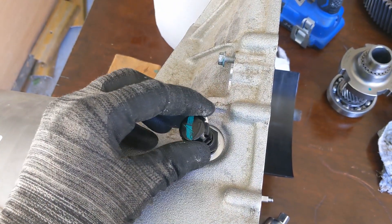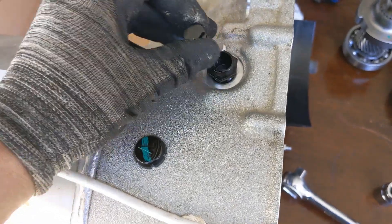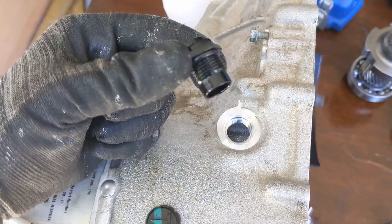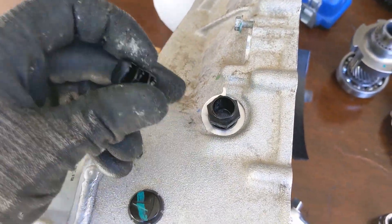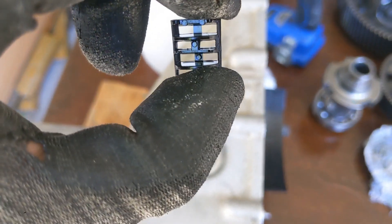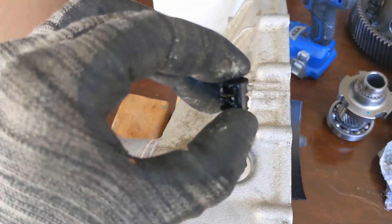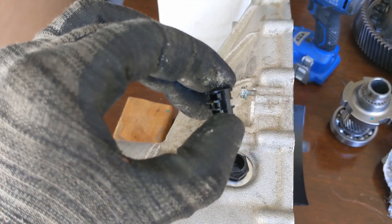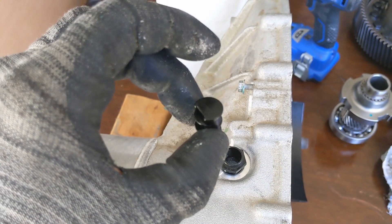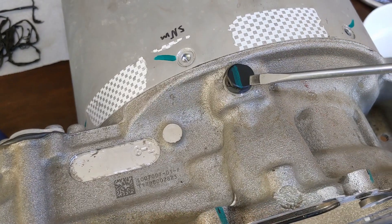You can disassemble the breather and take the cap off — it's a snap fit — and then it comes apart into two more parts. There's an external thread and it's threaded in here. It has a little labyrinth where the air can zig-zag up and down, but it's very difficult for fluid to splash out of, so the transmission oil stays inside.